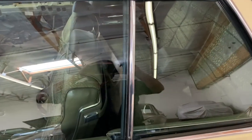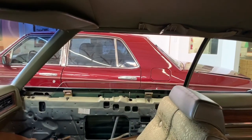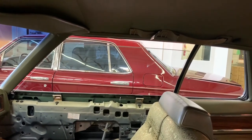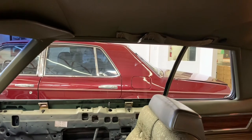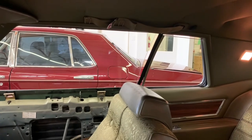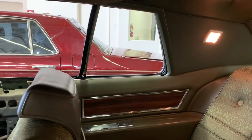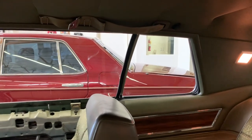As you can see, the passenger side isn't as tight as the driver's side here. I might end up adjusting the quarter window on the passenger side forward. But let's see what we've got going for now. Window went down, window comes up, window goes down, window comes up — slowly but up. The rear quarter window is now getting stuck. I think I need to move that quarter window forward — but we will address that next time.